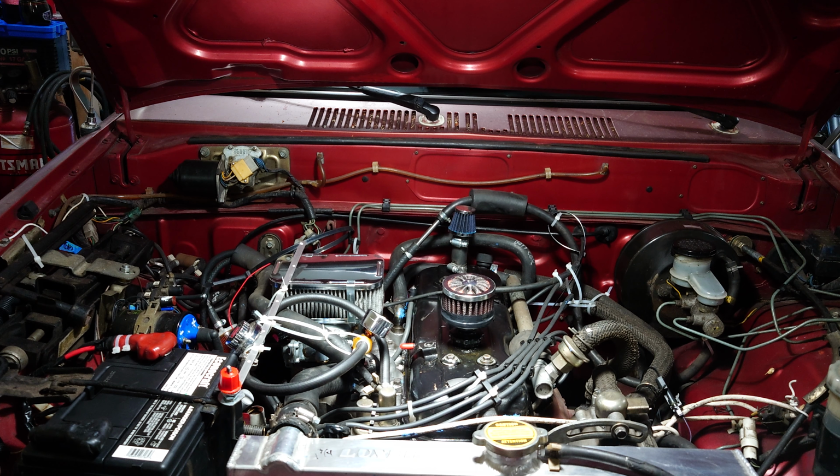The issue with the head bolts is, if they're reused, they can stretch, and since the engine is so old, the specs in the manual, which is, I believe, 72 foot-pounds, may not work, and it may not compress the head gasket enough to seal it properly.